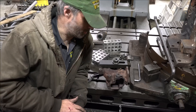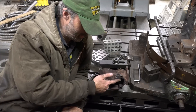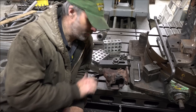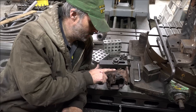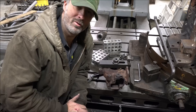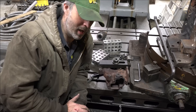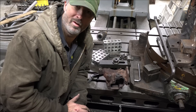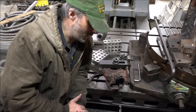If you're doing it like I'm doing, where you're going to take the waste-gated energy off of this turbo and dump it in to feed the big turbo — one of the nicest things about these S300 exhaust housings is they are dual wastegate ported, which is somewhat unusual in small frame turbochargers. Usually they'll just wastegate one side, and while that does reduce the turbocharger speed, it doesn't help the cylinder pressure on the ones that aren't wastegated. So on a six-cylinder, you've got three cylinders running at a lot higher exhaust drive pressure than the other three cylinders, which is not particularly good for head gaskets or engine components. This setup with the dual gates alleviates that problem and balances it all out.